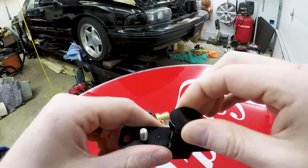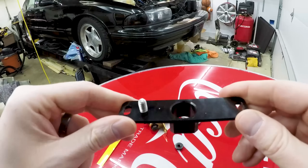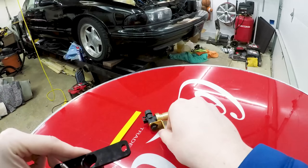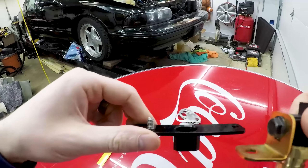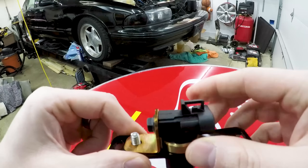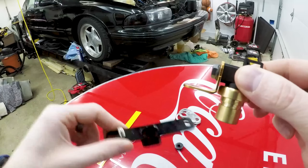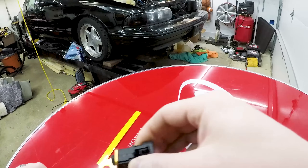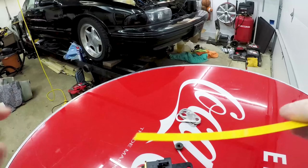What that tool does is set up this piece on the sensing unit. From there, you're locked down and ratcheted down. This is really the sensor — this is what's doing all the work. It installs right like that. Now there's no wiggle room anymore because you've already set up the piece that the gold part is bolting to. Once this is bolted down, they give you this yellow feeler gauge — basically a little spacer checker.